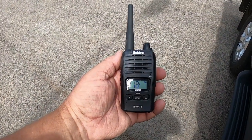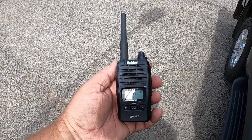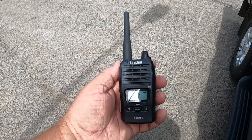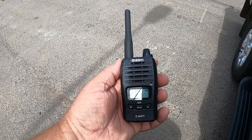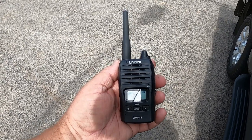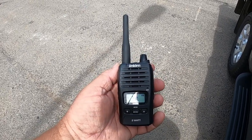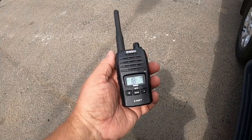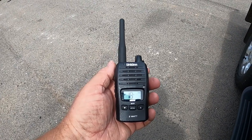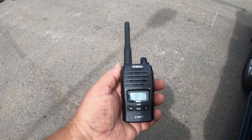If room is an issue, you can always go for a handheld radio — this one is only two watts, but if you're going to use it as your main radio it really needs to be a five watt unit. GME do a travel kit — a portable unit with its own aerial on a magnetic base for the roof. When you're finished, just pack it away; you can use it for your caravan trip and sell it when you get home, saving the cost of a full vehicle install. We use our little handheld when reversing the caravan — one person is behind the van and one is in the car, so you've got contact with the person who has eyes right where you're trying to push the van, which saves running into things.